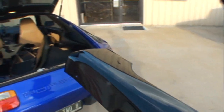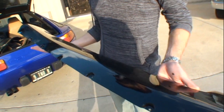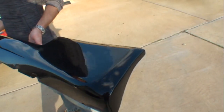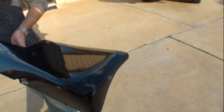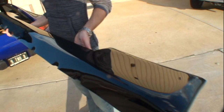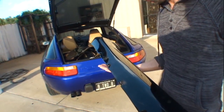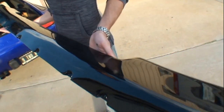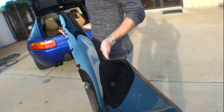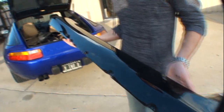It actually came out really good and I'm really happy with the product, but I'm afraid in years to come, the paint's probably going to shrink down from the Texas heat and the sun, and possibly due to the cheap fiberglass work on it, it's not going to stay this high lustrous gloss, but it will look okay for as long as we want it to look. And that's all we can do with what we got, using the wet candy clear, four full wet coats, color sand and buffing, and three full wet coats of paint before that.